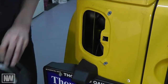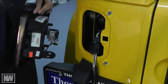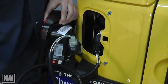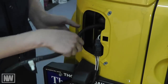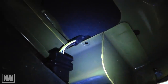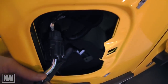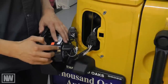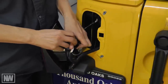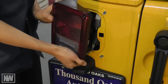With the tail light off, unplug the light and connect the new wiring harness between the original connectors. Feed the trailer end of the harness into the body and out through the bottom foam liner. Be sure to pull enough wire so that the trailer plug will reach the hitch. Attach the wiring harness to the tail light.